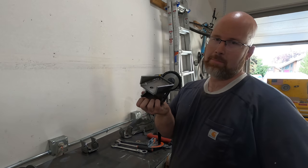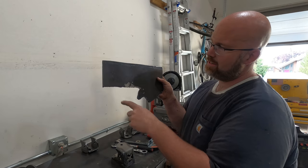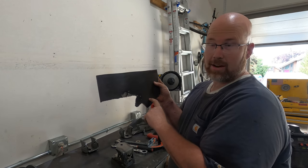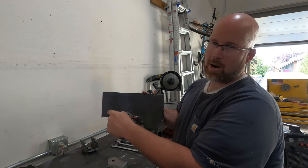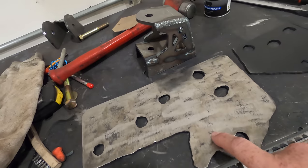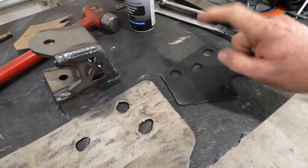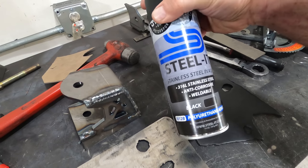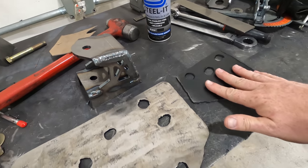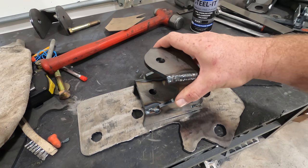I've got my upper bracket welded together — that's the TMR bracket — and I've got my plating cut out that's going to go on the frame down to the bracket. I just need to go underneath and figure out where I want this and mark where I'm going to put my weld holes. Through the magic of YouTube, here are the plates all ready to go with my weld holes in them — this is for the driver's side too. This is Steel It Paint — not a sponsor — but it's weldable stainless steel in a can. I put that on to prevent rust from forming underneath the plate after it's on.